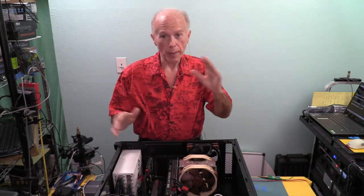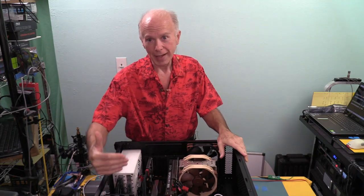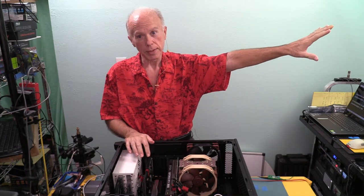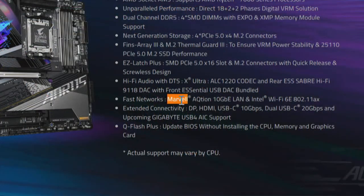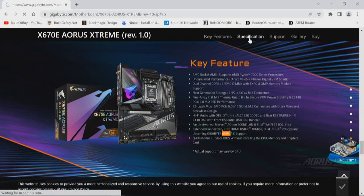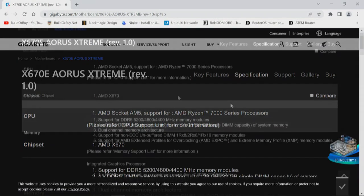So as we look at all these possible storage options, we have to plan ahead. You have to understand what you can and can't do. This motherboard also has 10 Gigabit Ethernet using the Marvell AQC113C chipset. Now let's go look at specifications, keeping in mind the one feature of USB 4 — the wording is different, which makes it tricky to find. We'll deal with slots and storage as the specs are outlined, referencing both the website and the motherboard manual.